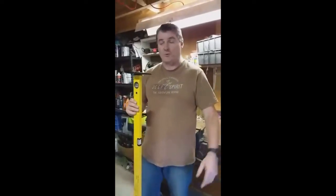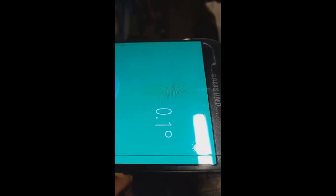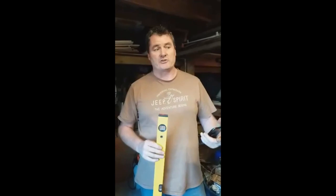In part two, I've done some more adjustments to show what it looks like. Placing the phone on here, we have minus 0.2 degrees on this side, and on the other side we've got 0.2 degrees. So if you add minus 0.2 and 0.2, that gives us exactly zero - neither toe-in nor toe-out. I'm going to try that and see how it goes. It's quite important to experiment with your handling because we don't have suspension to help - the only things we can adjust are tyre pressures and alignment.